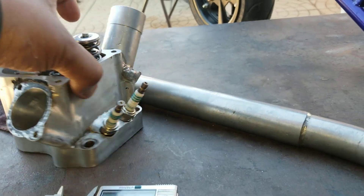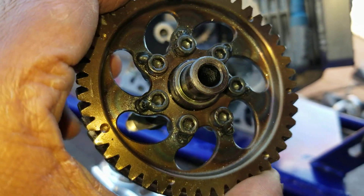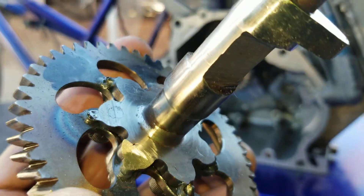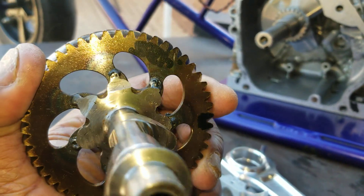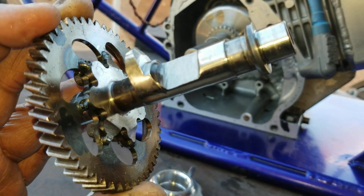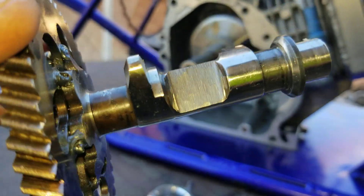Massive port runner, two spark plugs. Now this is the cam — you see all the adjustment holes are spot welded so it can't be moved anymore. The back clearance is also spot welded in the back. Cam is 425, custom Miski grind. This is the cam itself — see how it's clearanced.